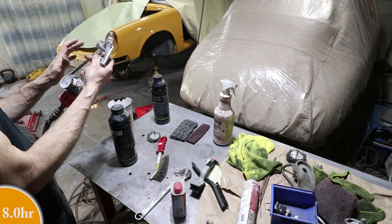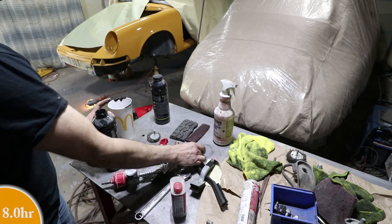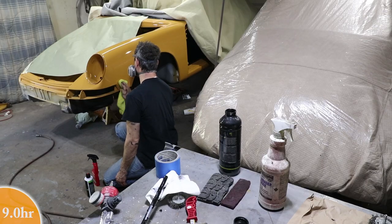I'm going with 35 pounds pressure, which is on the low side — I'm definitely looking for high texture so that should help. Here we go — that's the first coat down. It went pretty well; I put it on super heavy so I want to give it lots of time to dry because I really want that factory heavy texture. I did get a few spots on the yellow, really minor. I'm going to do a second coat but I'm probably going to wait until maybe even next week. I feel like I don't have enough material for the second coat and cleaning the spray gun is a big pain, so I don't want to do it three times — I just want to do it twice. I think I'm going to order some more just to be safe.